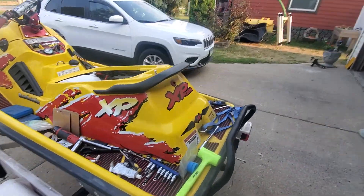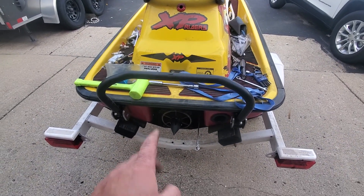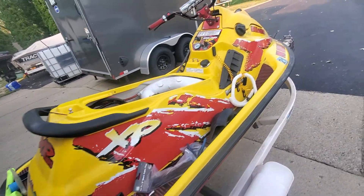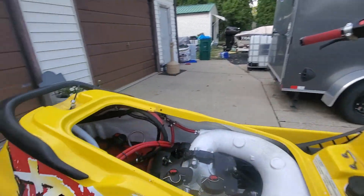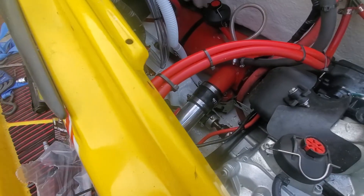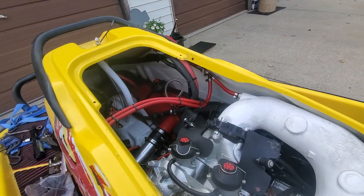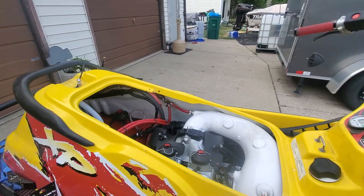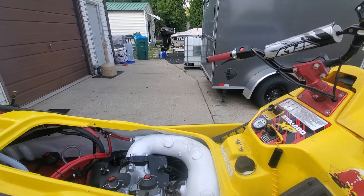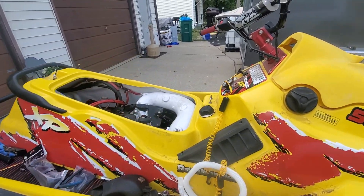I just got to get her cleaned up and make her look beautiful on the outside from all this work. I gotta get the pump nozzle back on — that's on my to-do list, won't take very long. Then the next big thing is working with this hydraulic trim, because I must have air in the system — it's really hard to pull. I'm hoping Nick at Westside, who I bought it from, can give me some help — maybe we need to re-bleed the lines.